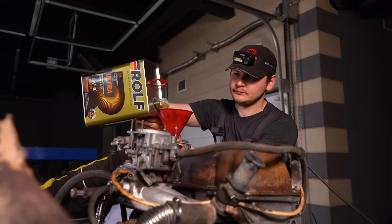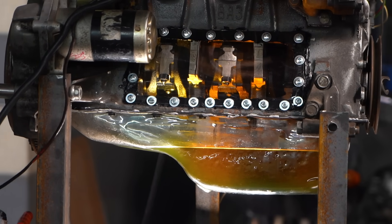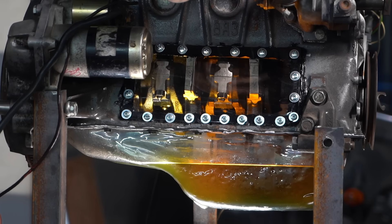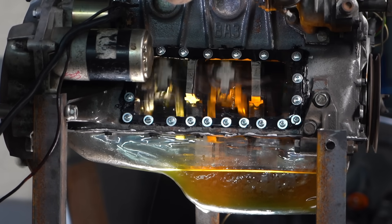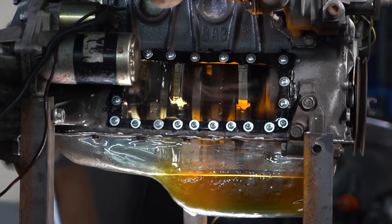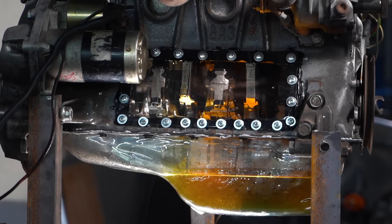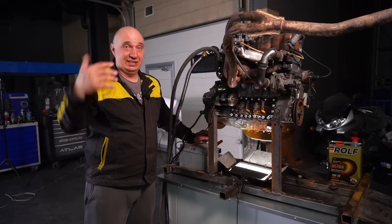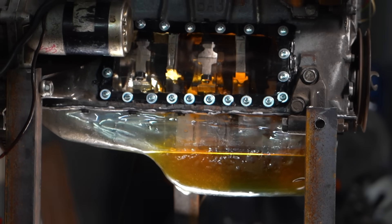The oil is on the max level — it goes right up to here. Let's start by simply turning the engine over and see how the pump performs its duties, how quickly it picks the oil up, and what happens to the level. The oil level has started to drop, and here we see it returning into the pan. The pump has picked up a certain amount of oil, transported it upstairs to lubricate the cam and crankshaft, and only once there was a surplus did it start to drip back down. If we wait a bit, it's slowly dripping down and will be back to baseline soon enough.